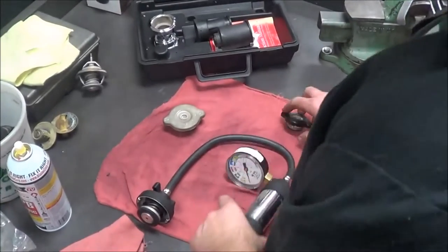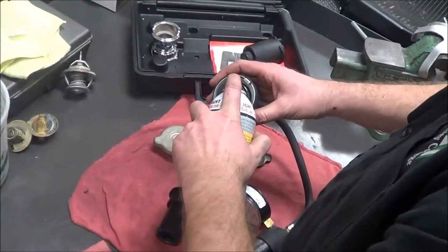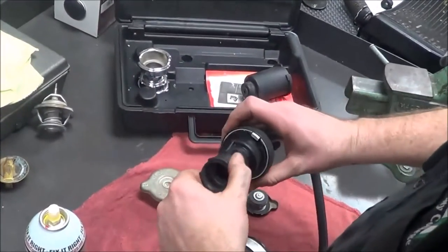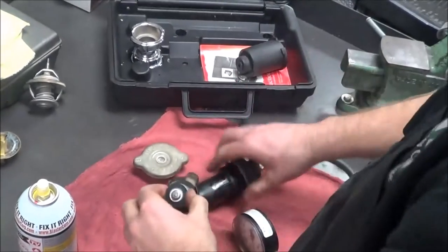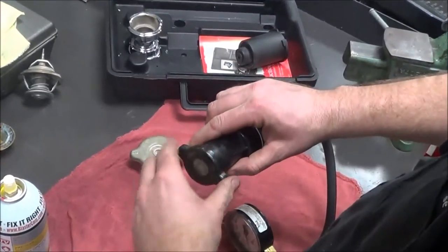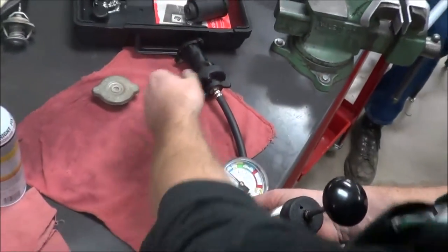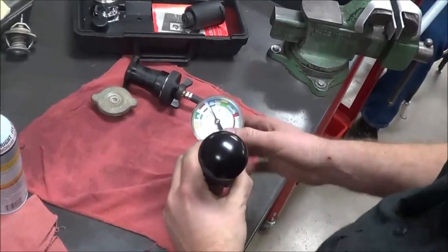Let's look at testing the cap. I'm going to use this adapter and I recommend lubricating the o-rings — if you don't, they can get a dry spot and spin on you. You can see there are ramps on here. Once there's a stopping point, I'll also lubricate the cap itself. A lot of people come up saying the cap's bad, but it's not. Put it on, compress it, rotate it around to the next stop — compressing that spring. This was the 1.1 cap, which I think is about 17 psi.